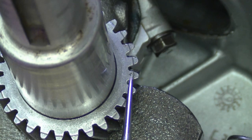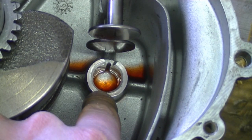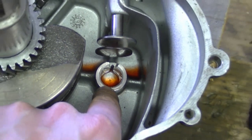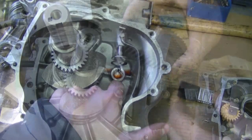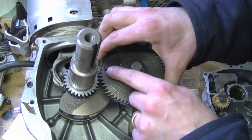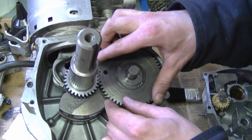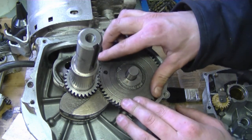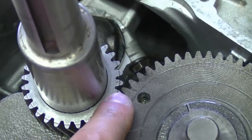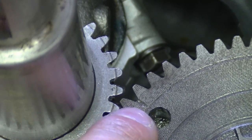So you have to line up this mark with the one on the camshaft. I've put a bit of oil where the end of the camshaft goes in, just so that when it starts it's lubricated. I'm going to install the camshaft back in so that the mark on it lines up with the one on the crankshaft. If you don't get it right the first time, don't worry about it — just try again. Here are my two marks and I believe once I turn the motor they're going to line up perfectly.